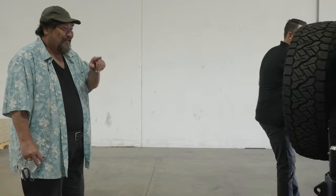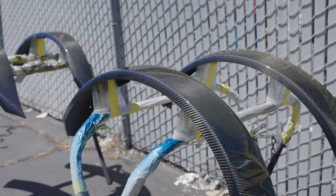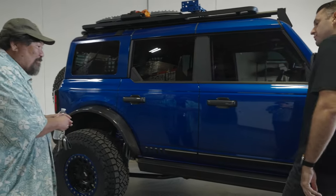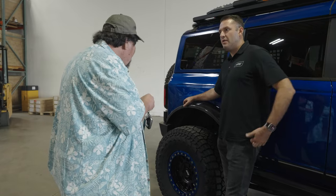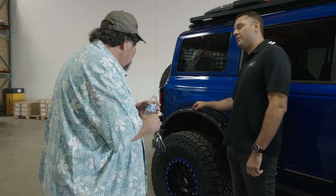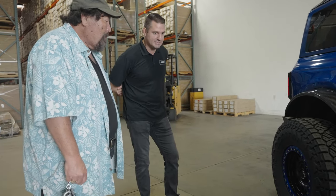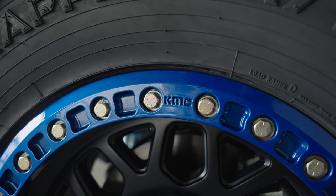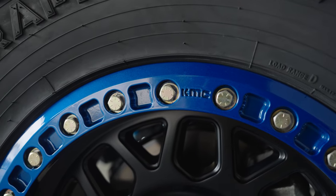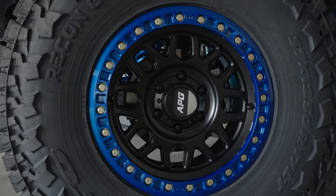I love the carbon fiber flares. It adds a lot. One of the things with all your carbon is so pretty, you're going to beat it up. The front tires are going to project debris rearward. So we have these wrapped in a high build film — as it gets pitted, beat up, or scratched from off-roading, you can peel the film and reapply a new film and the carbon is completely protected. True bead locks, so you can air down to zero PSI and that bead's not going to pop off. On a 17 inch wheel sitting on a 37 like this, you can go really low. For very slow, very technical rock crawling, you can bring it down to about seven or eight PSI.